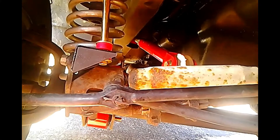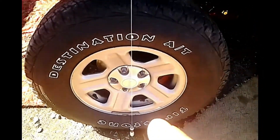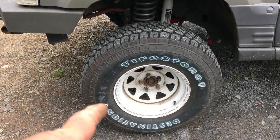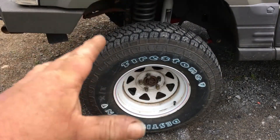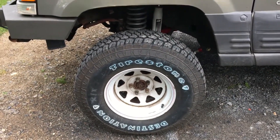All control arms are in. You will need a good ratchet strap because you've got to jostle the axle around a little bit. You can see the line is where it belongs — we pulled it back out to where it should be, everything is hunky-dory. Here we go: new tires, old rims, all control arms on and adjusted. As you can see, the wheel now does sit a lot more centered in the wheel well.